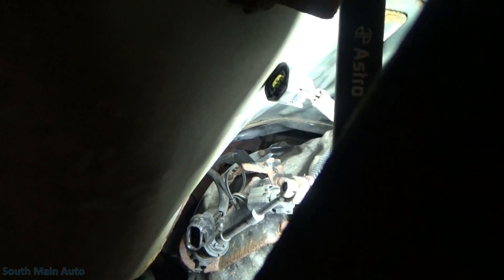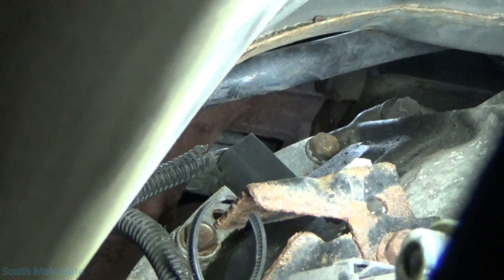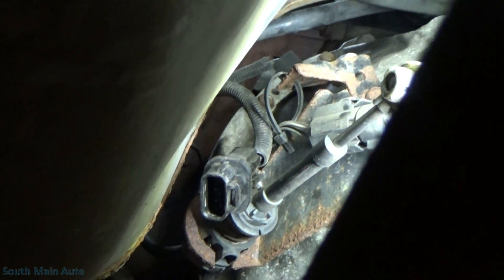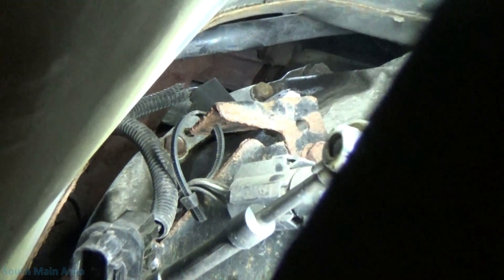So we're going to pick it up in the air and install the crank sensor. The crank sensor lives up there — that black thing at the top — and there's a bolt on either side of it. It comes down by that zip tie, and I've already unplugged it. There's the connector. This will give you the broad view of where we're at — it's just right up there by the transmission. A little bit easier than the Grand Cherokees. We're going to reach up there with a socket extension and swivel.